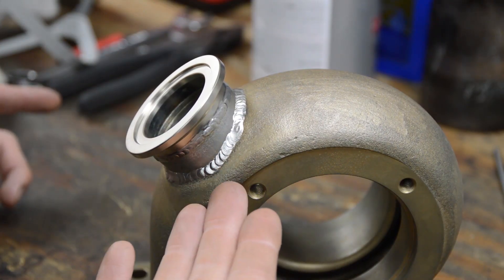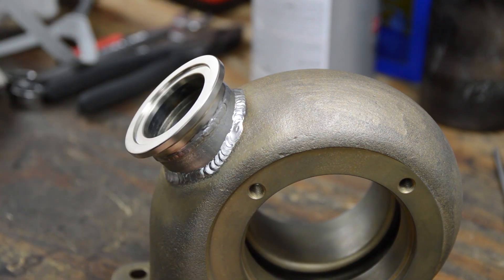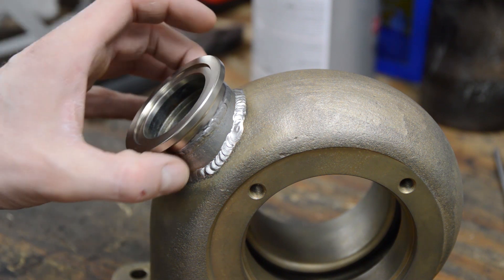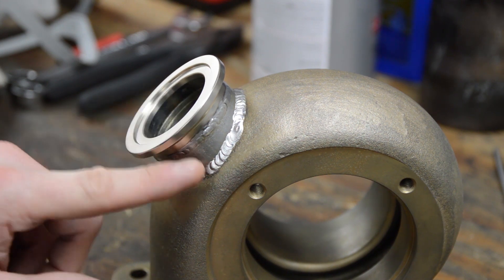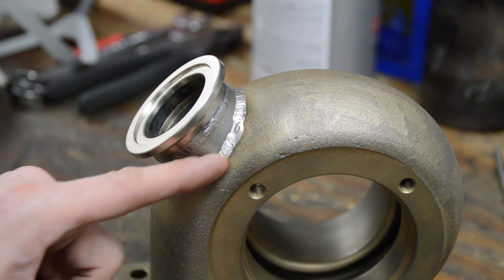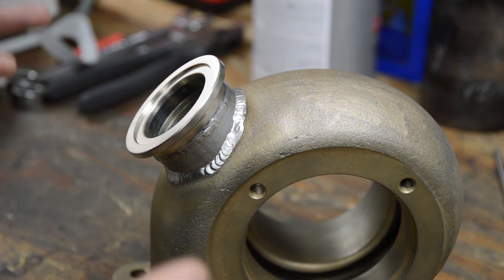Here's the housing — it is completely done, all welded. Let me discuss what happened. I used the hole saw on my workbench to punch the hole out, and I wouldn't recommend doing that. The hole saw walked around and I ended up with a 2.1-inch hole when I was going for 2 inches — a really sloppy fit for the 1.9 OD pipe I planned to use. So I had my cousin machine a custom piece that fit inside the lip and fit tighter into the hole, just because I goofed. If you use a hole saw, use a drill press or a mill.